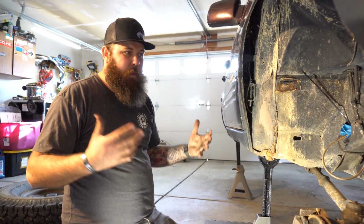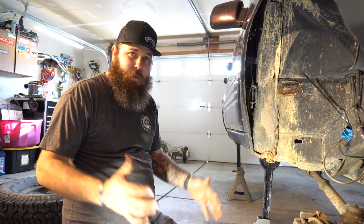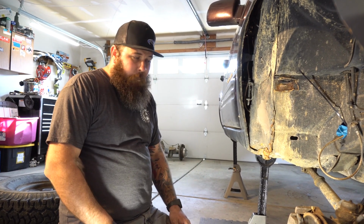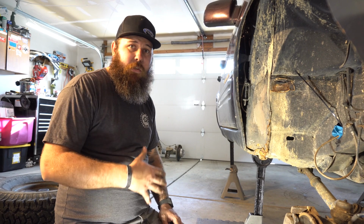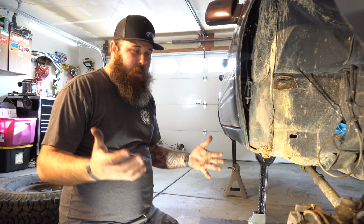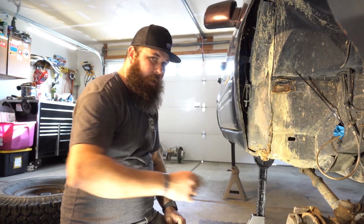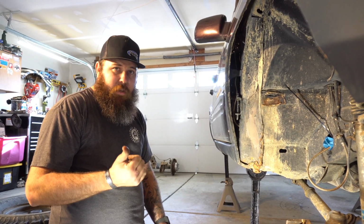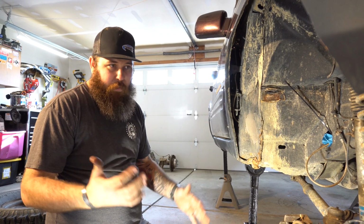And if you want just a bolt-in option, the Dana 44A, it is an aluminum center section, but they also used them in the Dodge Vipers, so they are very strong. You can use those as well, and those came in the 96 to 98 V8s. So there's plenty of good axle options out there. In terms of front axles, the only options for bolt-in that you're gonna have is a high pinion 30, the stock low pinion 30, or a TJ Rubicon Dana 44, but that is low pinion, so you kind of have to do a little trade-off there.